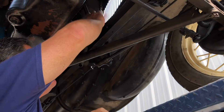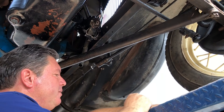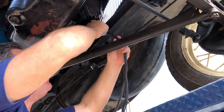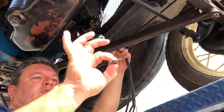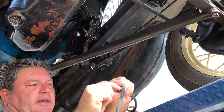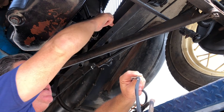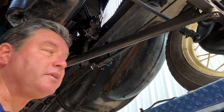There's the end of the steering column, and this is where the light switch mounts. I'm going to stretch the wiring harness out and lay it on the lift. I'll start attaching the wiring where it needs to go on the frame using these little clips — there are short ones and long ones. This clip goes over the top of the wire and clips onto the bottom of the C-rail of the frame, holding the wire right on top of the bottom of the C-rail. I'll get started on that now — you'll get to watch in fast motion so I don't waste your time.